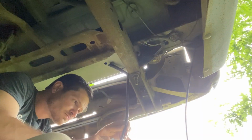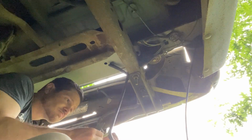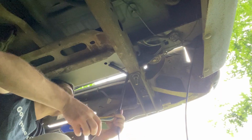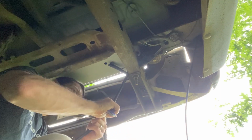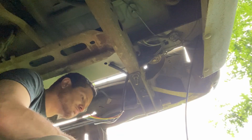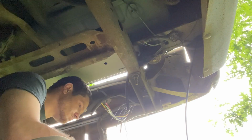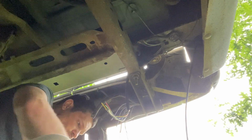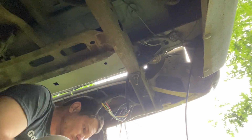Although it took a while, I did eventually get all this wiring to work. Turns out I had a short on one of my wires, and I had to go back and find and fix that. Blew a few fuses in that process, but that's just all part of trying to do vehicle wiring. It's kind of a pain sometimes. But I got it all working, and that pretty well wraps up the wiring that I have to do for now until I actually start tying up devices.